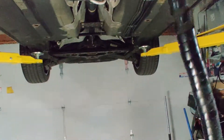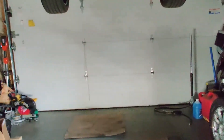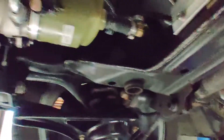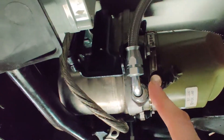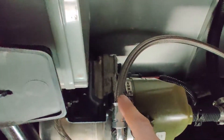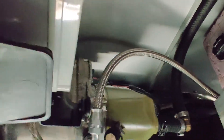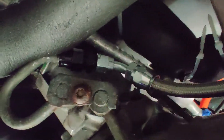So I had to relocate this line — that's the old ugly hydraulic hose from the power steering rack. I have replaced it with a custom-made line put together based on AN fittings. It's a high-pressure and high-temperature Teflon line in a stainless steel sleeve. It goes from the output port around and into the steering rack.